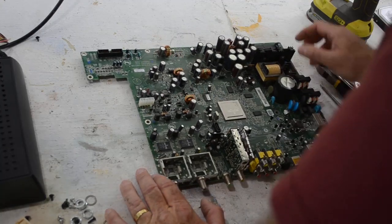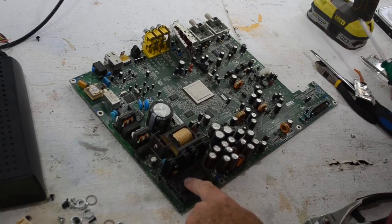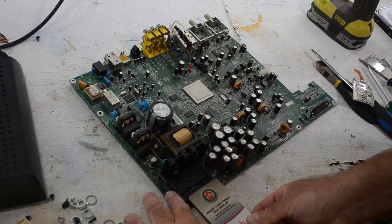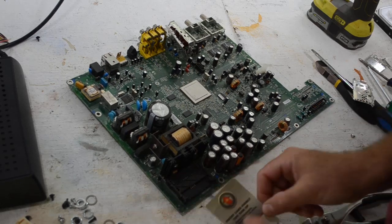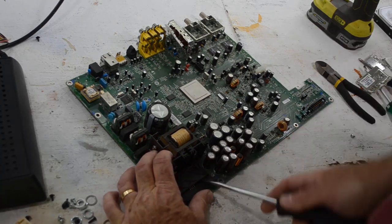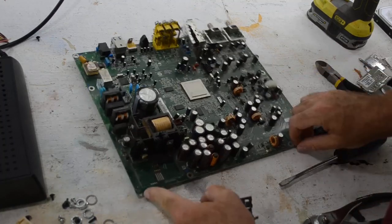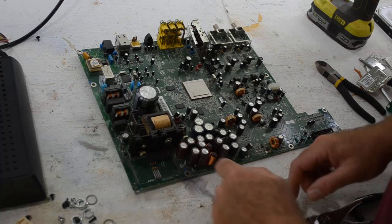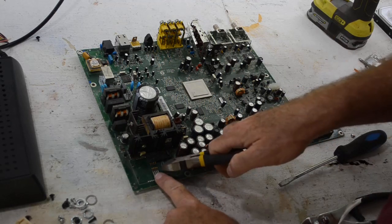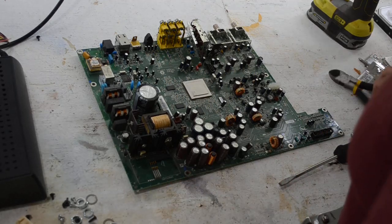So, oh, and one other thing, I'll bet there's gold contacts for this card reader, where this card slid in. Because usually, if you get gold on the card, it's almost always gold to gold. That's a good rule of thumb. So if there's gold on the card, there's probably gold on the pins that make contact with the card. And sure enough, there it is. There's steel, spring steel, with gold plating on the ends. Again, you can just take your diagonal cutters and cut off the ends with the gold on them, make a pile, and recover that gold plating.